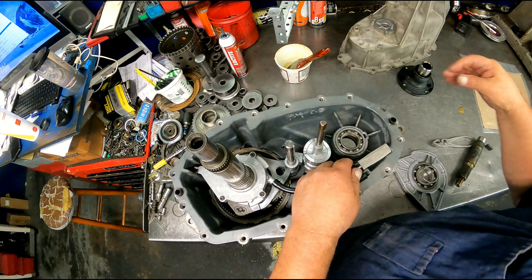There's no need to pull the output shaft out of the other section of case unless that bearing is bad, and there's a snap ring in there that you've got to undo to get it out. It's a super thin film of silicone — you don't need much at all. It's just going to squeeze it all out and then it's going to end up inside your unit.